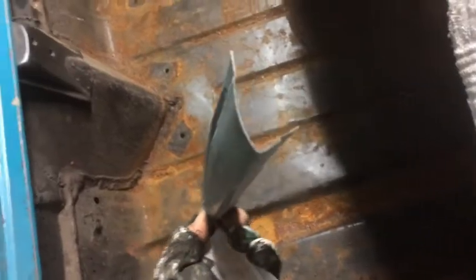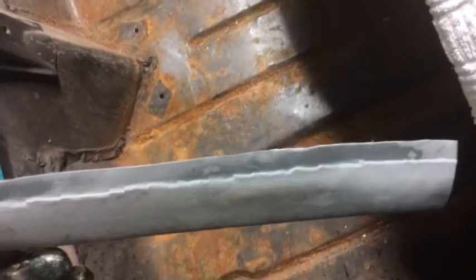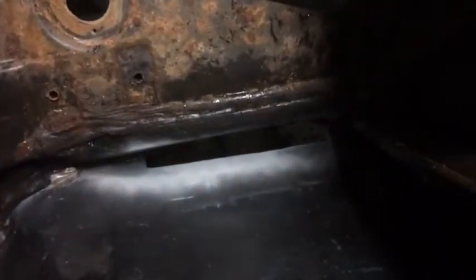I've had to reshape this a little bit to make it fit. I've put some flanges on it, and where the weld's going to go I've just put some weld-through primer. Now I'm just going to do a final fitting and then weld it into the gap down there.